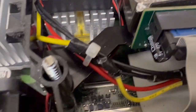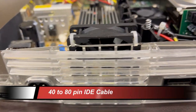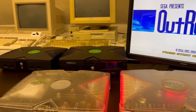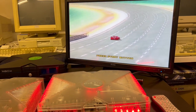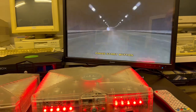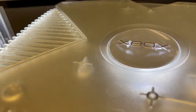The fan power supply comes from the Molex line to the hard drive — it doesn't affect its operation. There's the hard drive power, it's got a SATA to IDE converter, and I've changed to use that IDE converter. You've got to change the IDE cable to the 80-pin to allow that to function properly. Those were some of the design choices I used inside the Xbox to slim it down. The DVD controller board was the biggest decision — I couldn't find a way around it — but taking off a lot of the components and slimming it right down worked quite well.